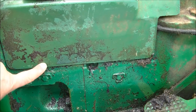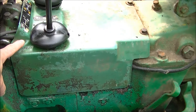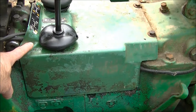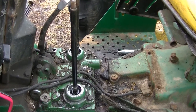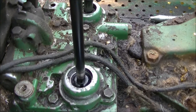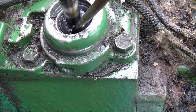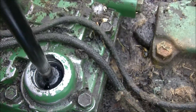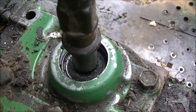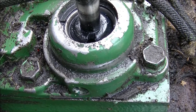This is where I'm leaking transmission fluid out of — it's coming out from underneath this cover here. So the first thing we're going to do is take this off and see what we can see. I've disassembled the cover and most of the gear shifts here, and it looks like I've got a crack right here. Compared to the other one, you can see that's just solid all the way around. So this piece of plastic is broken, and that's where all the fluid is spraying out from underneath.